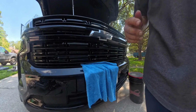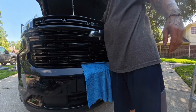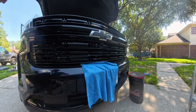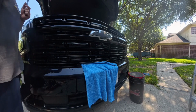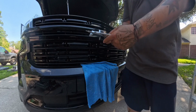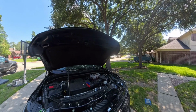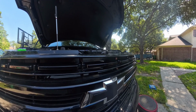Now we can come back and put those screws that we put aside. We need the T20. Two screws, T20, and your little connection that you made, your little hookup. So swap those out. Put the screws in your pocket if need be, if that makes it better. Now we're gonna screw those screws back in place.